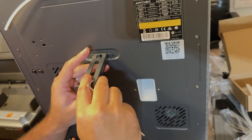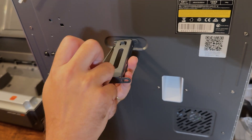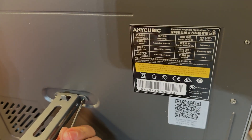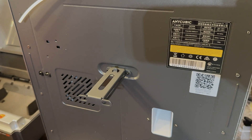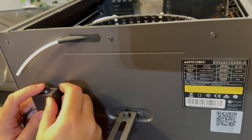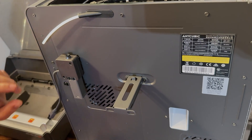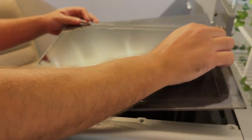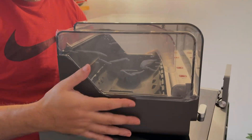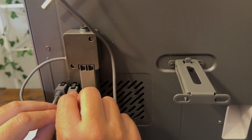Now it's time to assemble the rear of the printer. First I screw the single filament holder from the accessory box onto the back of the printer — we can use this holder when we're not using the AMS module. Now we attach the hub of the AMS module. This part will connect the 4 filament cables coming from the AMS. We secure it by tightening the 2 screws. Now I've placed the AMS module on the printer and connected the cables for the AMS module and the hub module. I also connect one end of the 4 filament flow tubes from the AMS module to the hub module and the other end to the back of the AMS module.